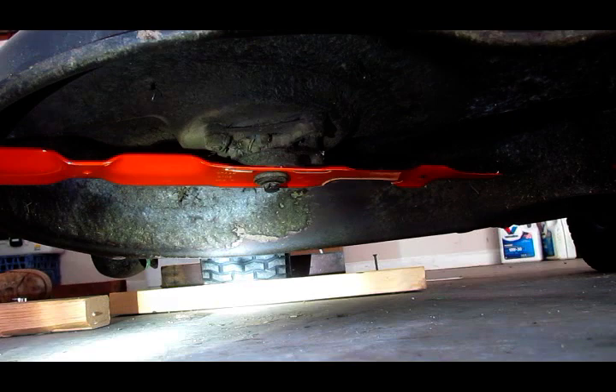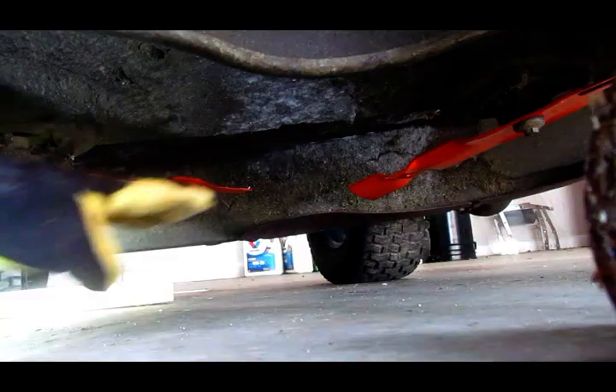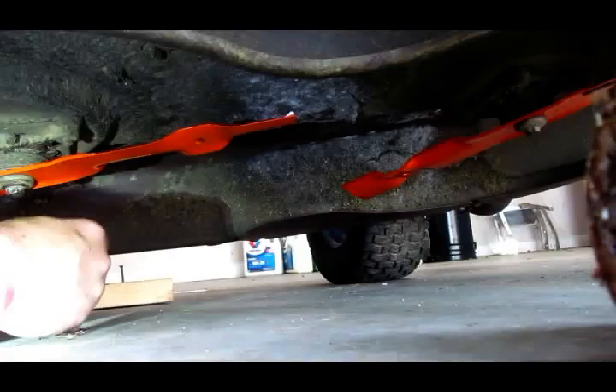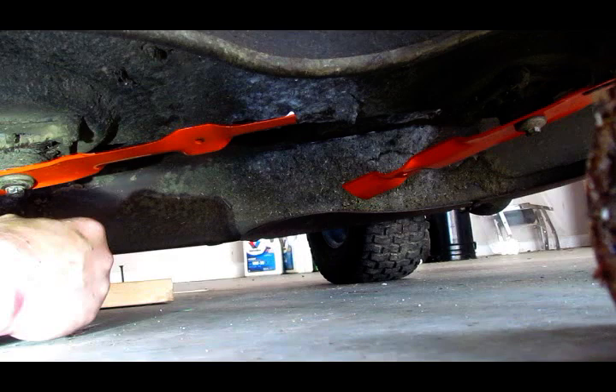Rather than bore you with the details of putting on a second blade because it's exactly like the first — both blades are on, I've already made sure they're fully up where they're supposed to be against the shaft shoulder, the center bolts are put in, snugged up, and torqued. Now the only thing to do is let the tractor down, get the chocks out, and I'm good to go, ready to cut grass. Thanks for watching — subscribe to my channel if you like, check out some other how-to videos. Be safe cutting your grass, make sure to use eye protection, ear protection, and sunscreen. Till next video, I'll see you later — thanks.